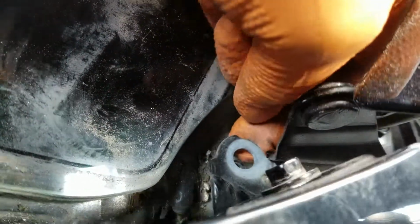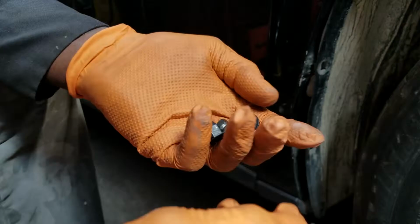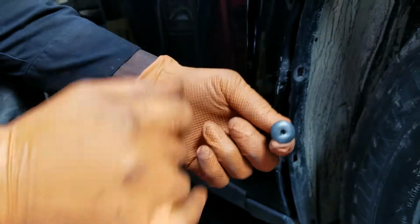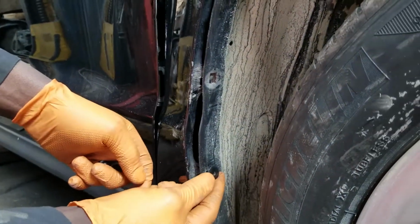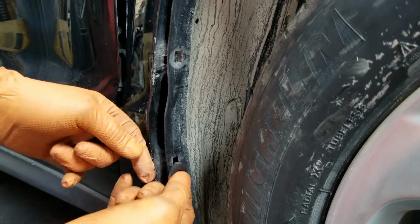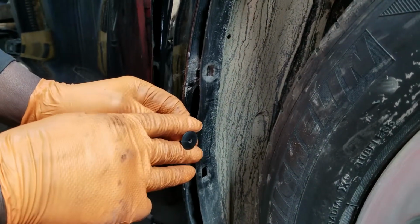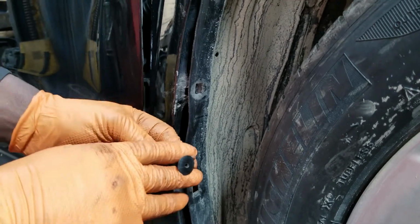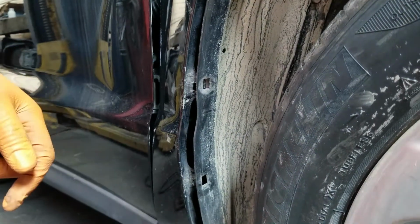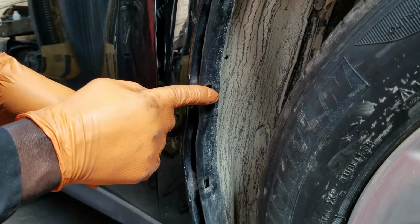I've removed that screw from there. Okay? Then down here, these plastic clips, there's 2 different styles. This one here, there's a pin in there, right? So let's go in here to hold it in. Just take a punch or something small enough and push the pin through. And if you have the correct tool, which will fit underneath like this, looks like a flat screwdriver with a cutout in it, and pry it out, or you can just use the screwdriver on the side and work it out. So that style that I just showed you, there's one here, one here.